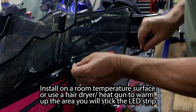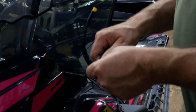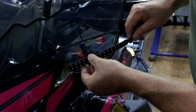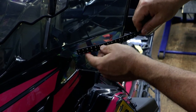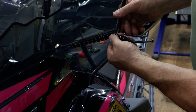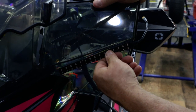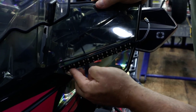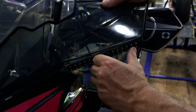Using the supplied alcohol wipe, prep the area where you're going to apply the LED strip. You'll want to do this in a garage that's at least 65 to 70 degrees in temperature. Then pull the release liner off the 3M VHB tape on the back of the LED strip and apply it to the area, leaving enough cable to wrap around the windshield to run the wires on the back side. Very firmly press the edges of the LED strip into the surface so there are no air gaps — that way water and snow can't get under there and freeze and push the LED off.